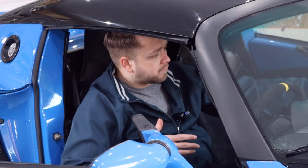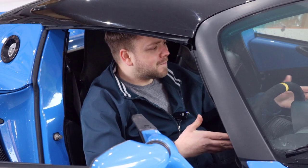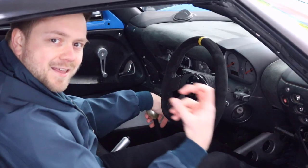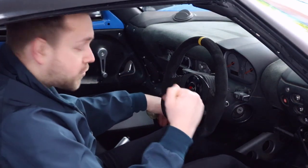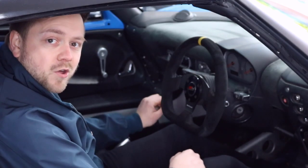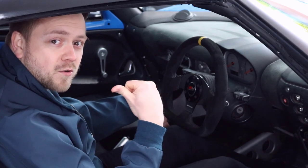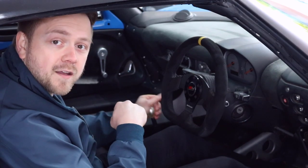As you sit in here, before you fire the car up, check the things the MOT doesn't necessarily cover — the radio, the heater controls, and if it's got electric windows fitted. These were actually a failure point in cars a little newer than this and could be a really costly fix. Also be aware of the gear linkage — it can sometimes slip off and, whilst it's not a big deal, it has the potential to strand you. Give that gear stick a good shake.